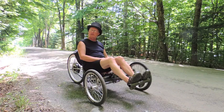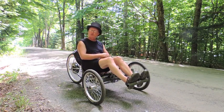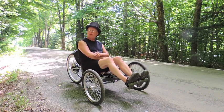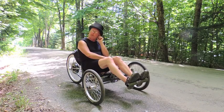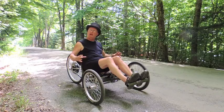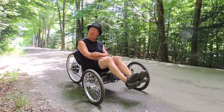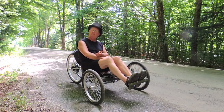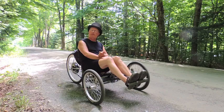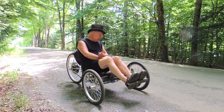I've been running it this morning — I've got 10 miles on it. The voltage when I started out was 53 volts. They're gel cells, about over 13 volts apiece. I've got four in series on each side, wired in parallel, so I had a working voltage of about 53 and a half when I started. I've driven it 10 miles up and down the road and right now the voltage is at 50.4.